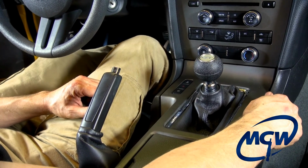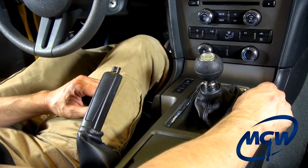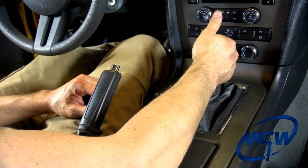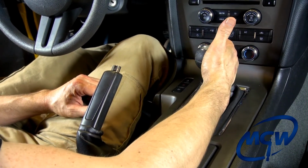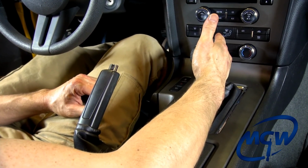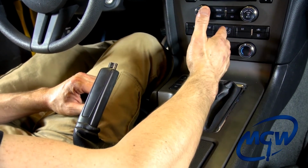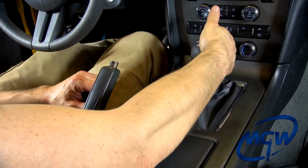Doesn't happen on ours. Another method that you want to make sure you use that is not the same as the OEM, you use that. Hear that little clicking? That is that hardened plate and pin. Goes right into first gear. When you're ready to load up into a second gear shift, you want to actually push that thing up against that plate and use it as a guide. That way you don't accidentally go into fourth gear, because the springs on ours are much stronger than the OEM. So you just lightly do it, pull straight back, and go right into second gear.